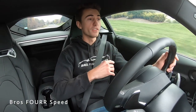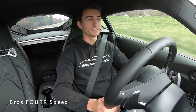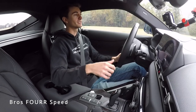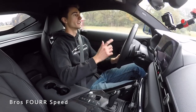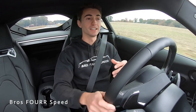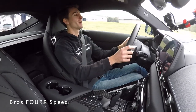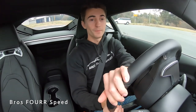Number five: launching your car. If you have an automatic sports car, some people do a 'neutral drop' — keeping the revs higher in neutral then slamming it into drive. As we discussed with the torque converter, one side is spinning very fast in neutral while the other isn't moving. When you slam it into drive, the pressure instantly connects both sides — that's a massive amount of stress on the torque converter's internal bands. Not recommended at all.